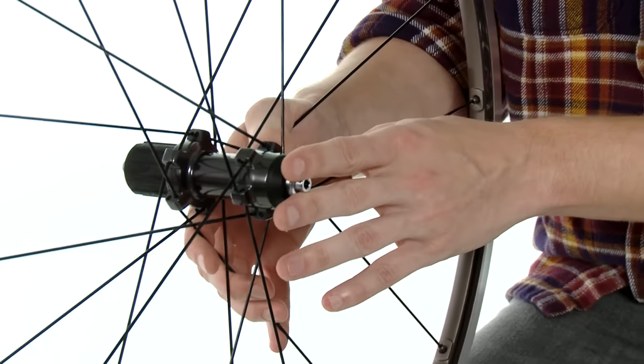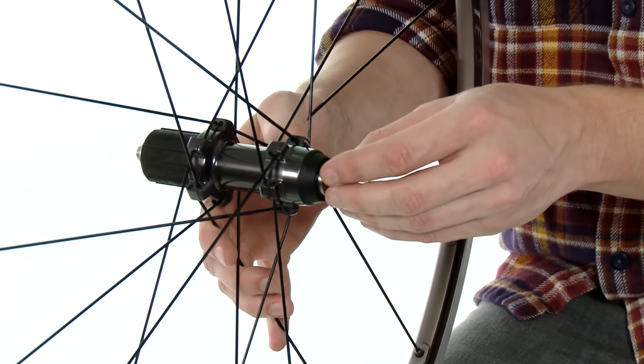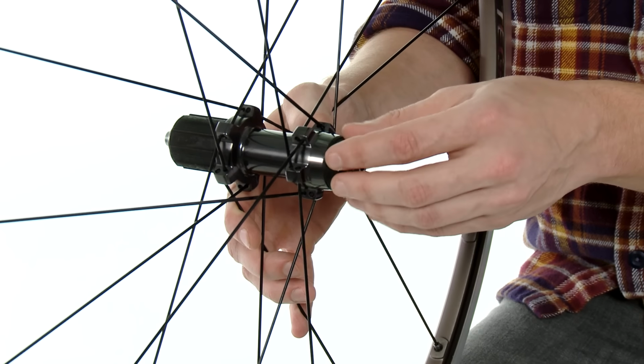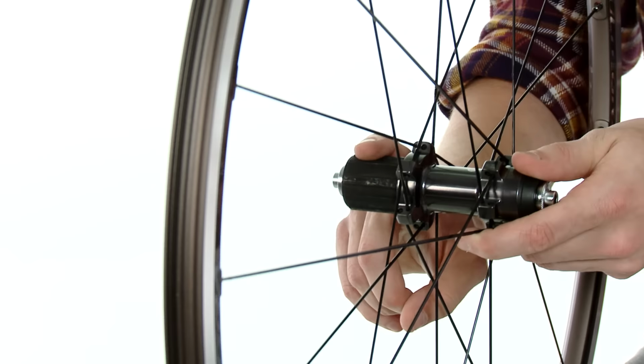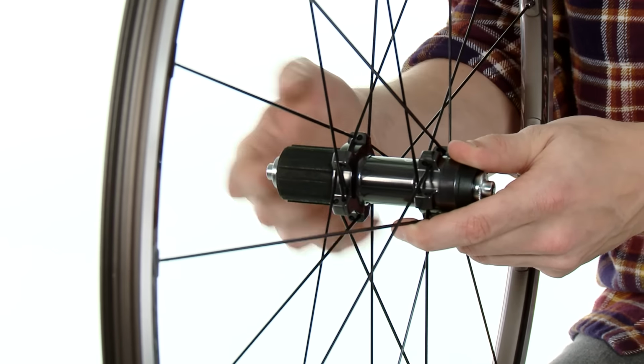As you'd expect from a Shimano wheel, the hubs are going to roll on a cup and cone style angular contact bearing, which do a great job of holding up under the forces that a bicycle wheel receives. The free hub body on the rear is going to be 11 speed compatible, and it's going to be steel, so it'll be very durable and resist notching from a cassette.